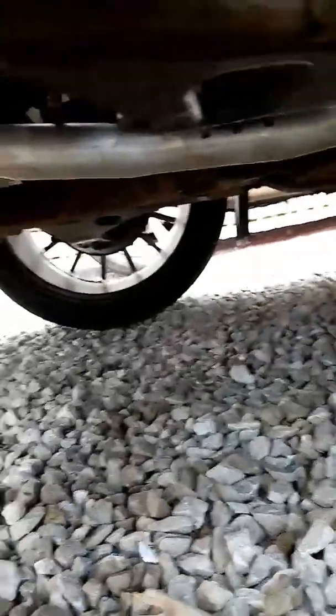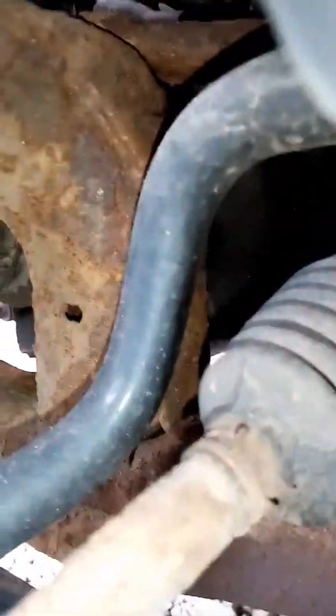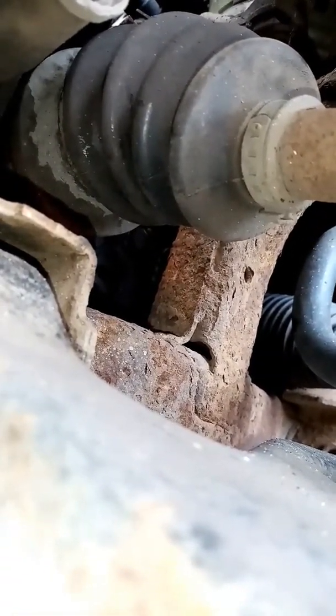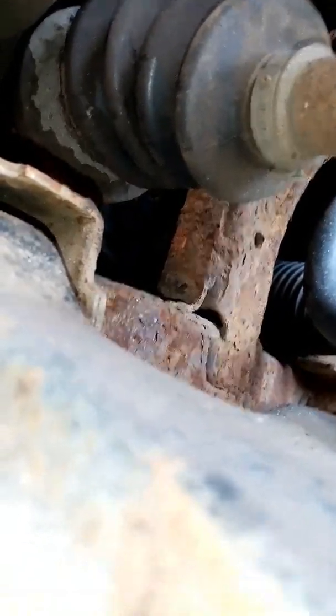The sensor's coming up. As far as I'm aware, the levelling plug is in there, just right next to where that CV boot is. But it's a bit of a pain to get to. We need to get under the car — I can see it there, that little bolt, right about there. Just in the middle of the screen. I think it's a 13mm bolt. We're going to undo that and check what level the oil is at.